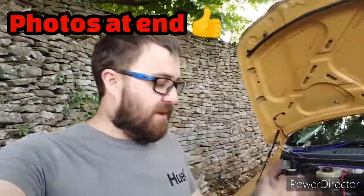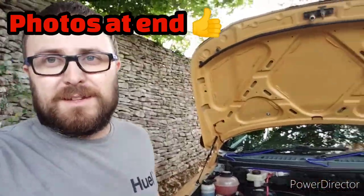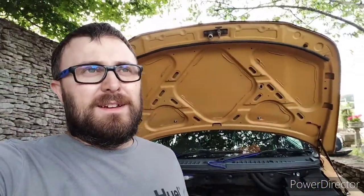Hey guys, so this is just a bit of an impromptu video. I've been going through and doing the vacuum hoses on the Freelander. For a while now I've felt like I've had a slight loss in power - I just didn't really have the same punchiness to the engine. And the brakes felt a bit weird, a bit hard at points, and it sort of bounced the idle. So before ripping the whole engine apart, I'm just going to do the vacuum hoses.